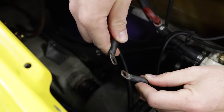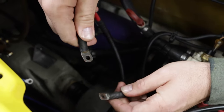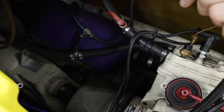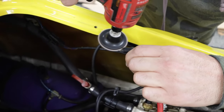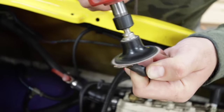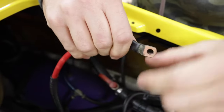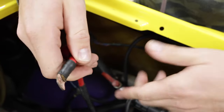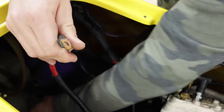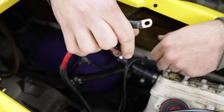After we do the rear ground, I always check the power and ground terminals to see how they are. These terminals are kind of dirty — you can get a piece of sandpaper, a wire brush, or use a little whiz wheel with about 320 grit and just clean them up. That gives you a nice fresh contact. Since I'm storing this over winter so it doesn't get corrosion again, I'll take dielectric grease between my fingers, pinch it through, and leave the grease on the terminal. Your goal is not to take metal away — just clean it up so it's nice and copper again.